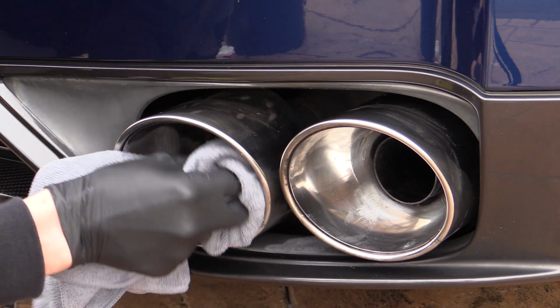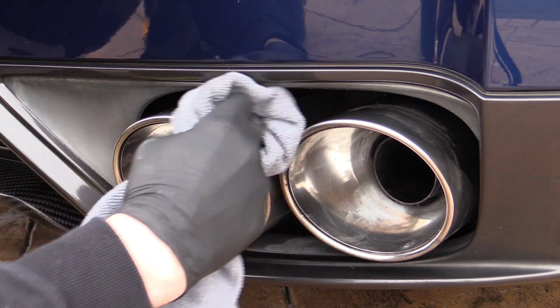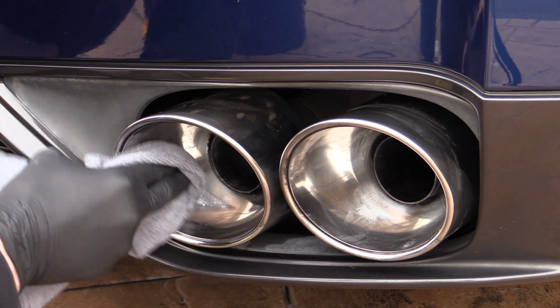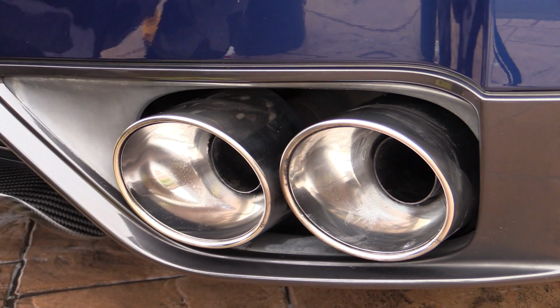Once thoroughly buffed, the black residue was wiped away before the process was repeated, this time with the power cone. The idea being that the tapered tip of the tool would hopefully access the tight areas the power ball may have missed.